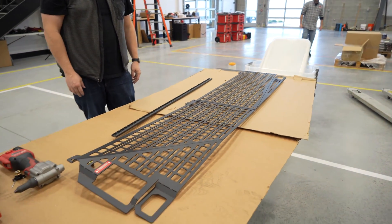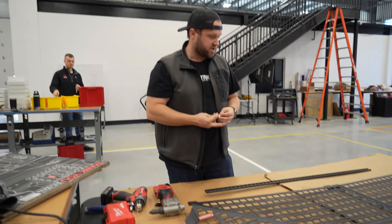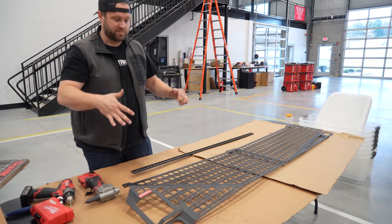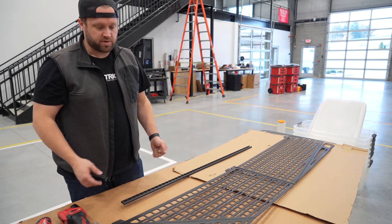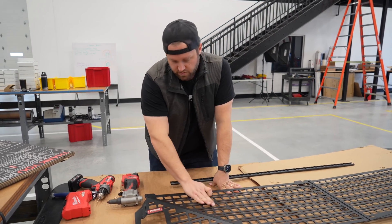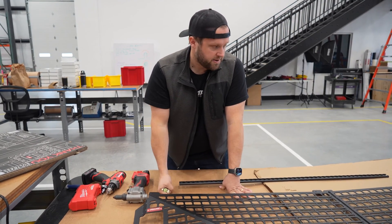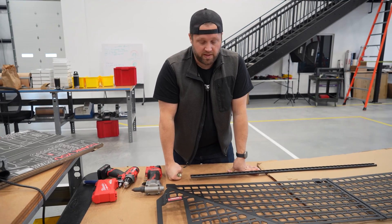It's quite a panel — a lot of metal. These are going to be expensive to make. Aluminum will at least make them easier to manage. The odd shape of the bed kind of forces us to put these bends in the panel if we want to keep them tight to the bed, which we do. That's going to help add rigidity to the panels — a perfect opportunity to use aluminum. There's also a conversation about whether to make the panel flat all the way back, but in the Cybertruck there's storage underneath with latches where the bed flips up, just like in the Rivian. We don't want to do anything that would prevent you from being able to open that.